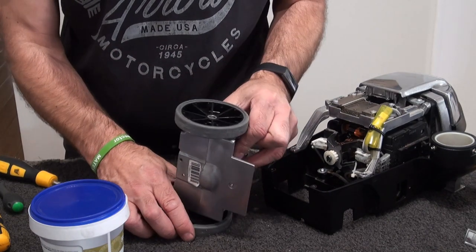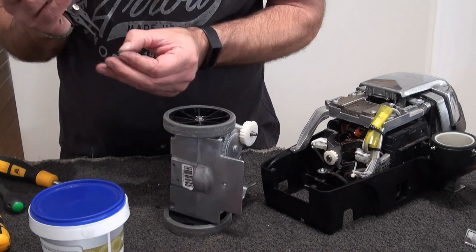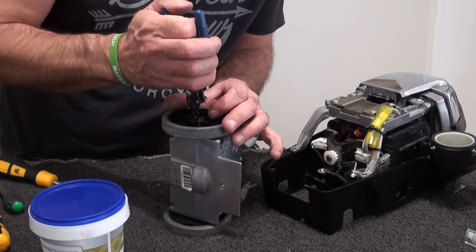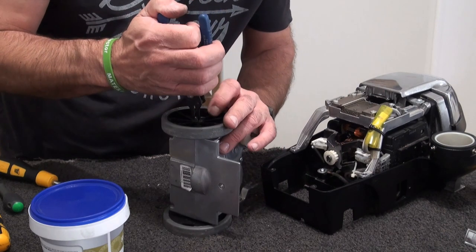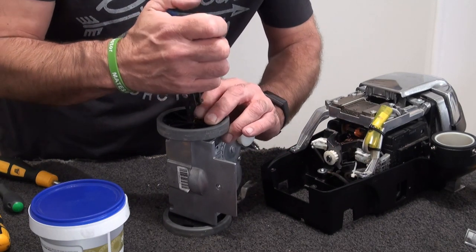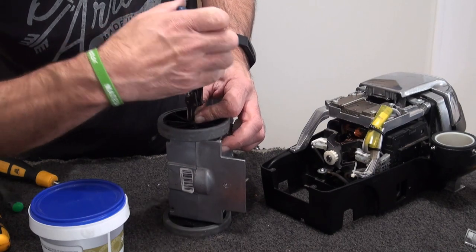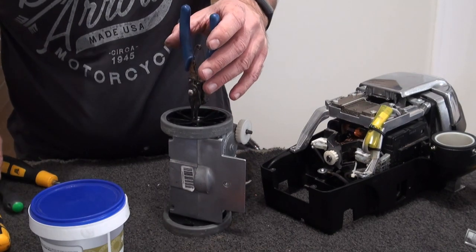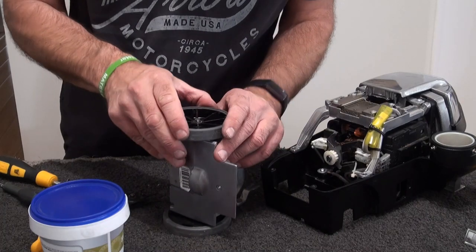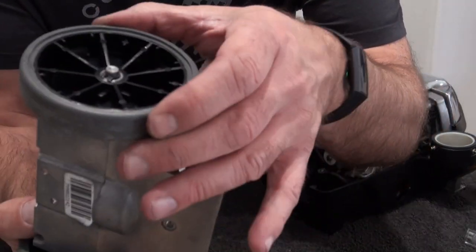Okay, this spindle does move up and down, so just bear that in mind. When you've taken the wheels off, it's not something that's dropped, it's just the fact that that axle shaft moves back and forth. So, open her up. Close that, and then try and wiggle. Close and wiggle that out. There we go. So again, make sure that that circlip, and you can see it, is perfectly locked in.